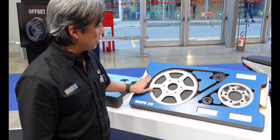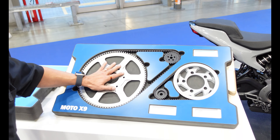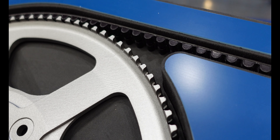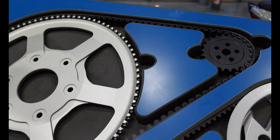This is an overview of what a system looks like — you've got your two sprockets and our belt system. This particular belt has a small groove in it called CenterTrack, which is a patented technology from Gates. It helps keep the belt centered on the sprocket and also helps reduce noise levels, making it quieter.